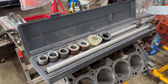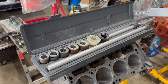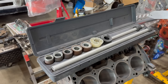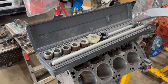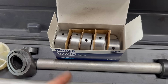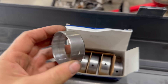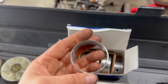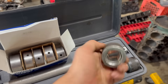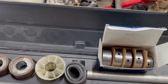This is a cam bearing tool. I think I bought this thing off Amazon for $120 like 12, 13 years ago, whenever I was doing my first engine build. I bought it so I could knock some new bearings into the 360 block I was assembling, and I didn't want to pay anyone money to do that. I have used it a good few times since then. Usually, I let the machine shop do this — if the block is going there, I just feel like it's good insurance. If anything goes wrong, well, I have someone to blame that's not me. Cam bearings are a one-piece bearing that has to be driven in and out, and special care has to be taken to ensure that the oil hole lines up the correct direction. We use a collet attached to this driver tool, with an expanding section that expands the collet into the bearing. A nice soft rubber will protect the bearing as you're smashing the tool with a hammer and driving it home.